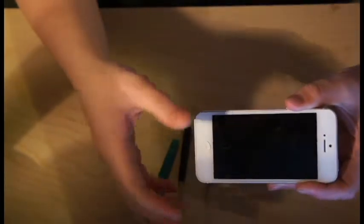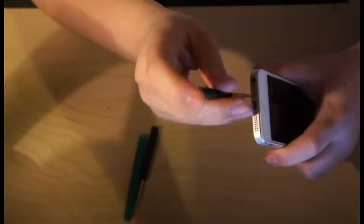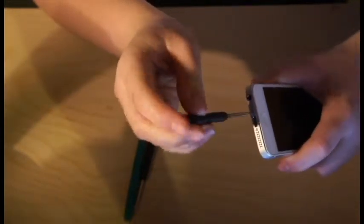The iPhone 5 — you access everything through the screen, so you take the screen off first, unlike any previous generations where you slide the back off. So with the pentalobe screwdriver, I'm just going to unscrew these two screws here.